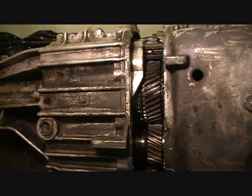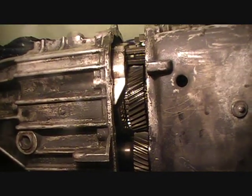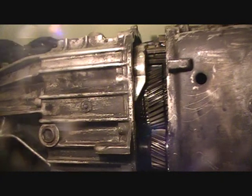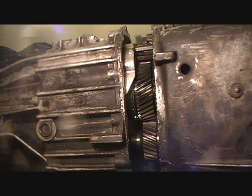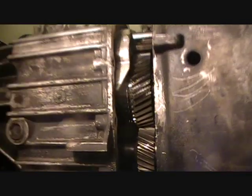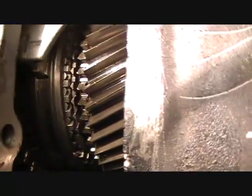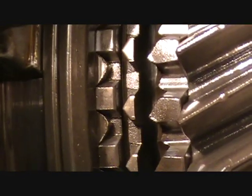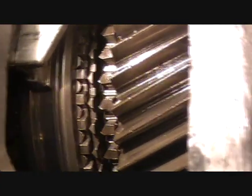All this I've never messed with before. We're going to look at that, order the right parts — bearings and stuff — because the transmission makes a whiny noise. It's just whining at any RPM. I'm thinking it's bearings. When you look at those synchro rings and what's been said online, apparently those rings are in very good shape. If anybody out there knows anything about rebuilding manual transmissions, you can give me some advice because I don't really have any idea.